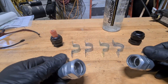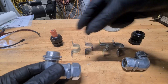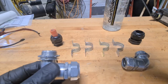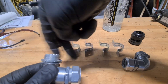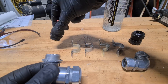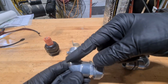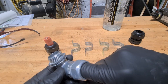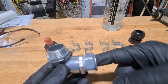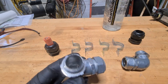These are both compression fittings that go on the end of the pipe and clamp down. This one will go through the floor of the frunk and tighten down. In order to get the cable through — this is a quite tight radius which worries me a little bit, and it's a little rough inside — so I'm going to deburr that and see if I can remove some excess material to make for an easier bend.